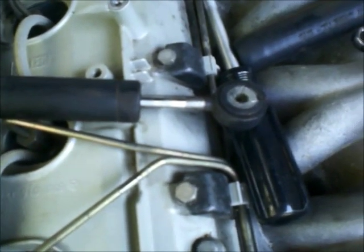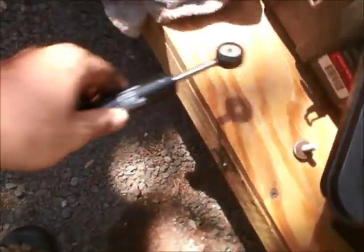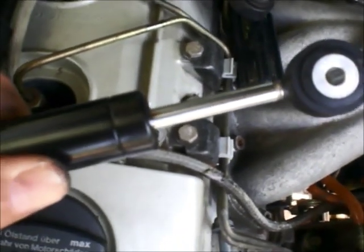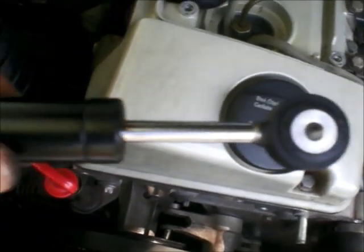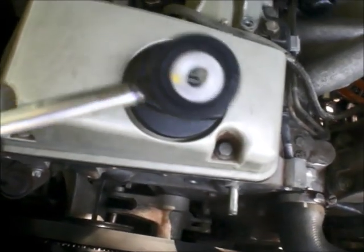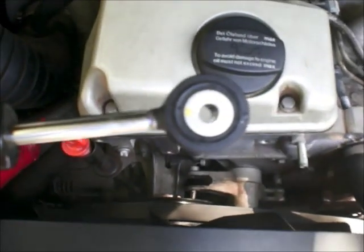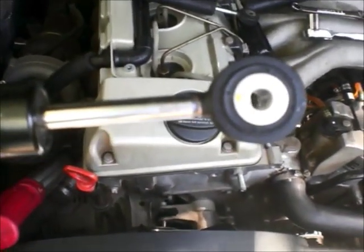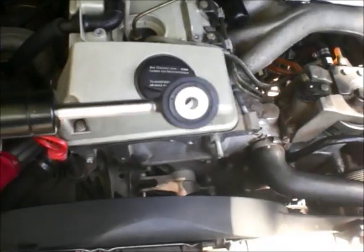The installation is basically the reverse of what we did, but there's one more important thing before you install the shock on the tensioner assembly: you have to initiate the shock. Grab it on both sides and work it — compress it in and extend it out all the way. They call it initiation. Do it very slowly; it will give you big resistance. Move it two or three times — that's the moment when the shock is ready to be installed and will work properly.